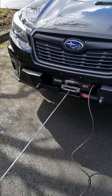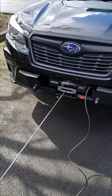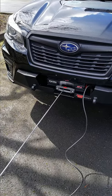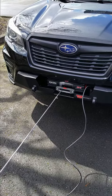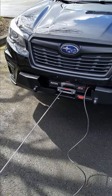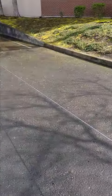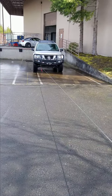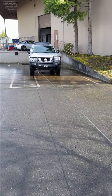One of the things you want to do is just make sure that the rope is going onto the drum nice and straight. If it ever goes sideways on you, you can just let off the remote, back it up, lay it nice and straight with your hand, and then keep going. As you can see here, the Xterra is slowly moving forward. I'll go ahead and finish this up and show you guys some pictures with the final product.